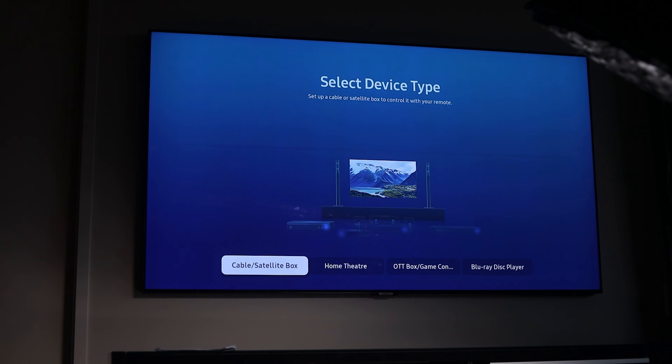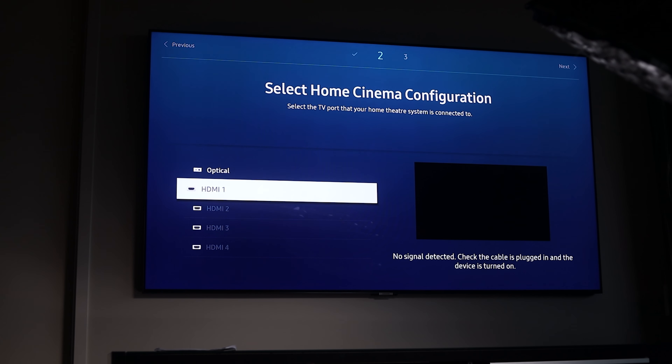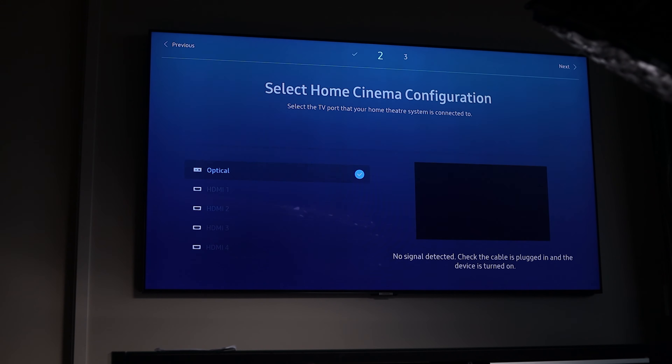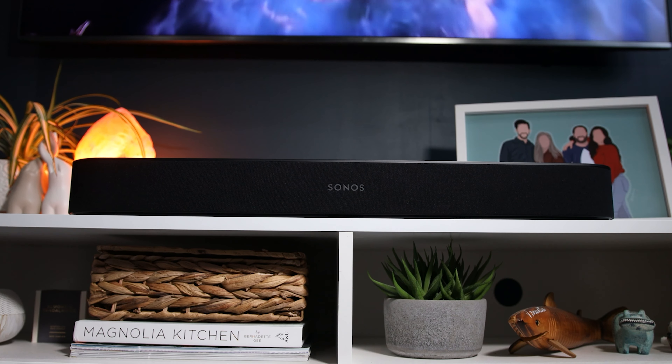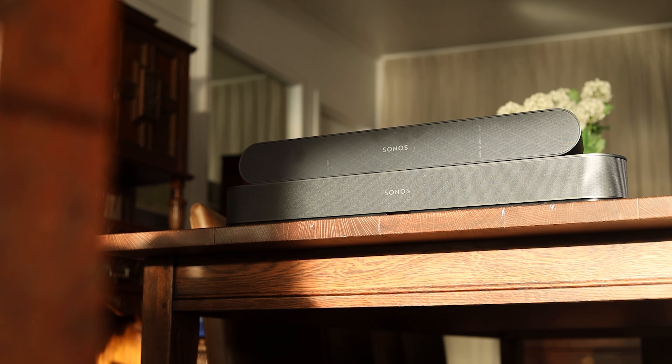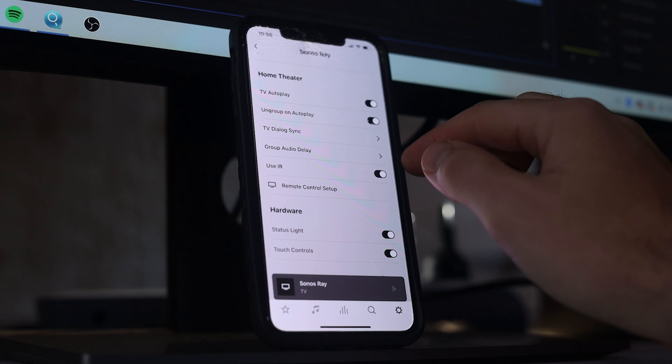While you're in there, set the audio format to PCM as optical doesn't work with Bitstream and will give you a loud buzzing noise, which is easily fixed by changing this setting. With many Samsung and LG TVs you can set up a universal remote which lets your TV remote control the soundbar's volume by sending out the correct signal for your particular soundbar. It's fairly easy to do and the TV will walk you through the steps. Unfortunately it won't turn the soundbar on or off like ARC does, but having volume control from the TV remote is a nice feature for everyday use. Some soundbars like the ones from Sonos will turn on when they receive an audio signal through optical, so check your owner's manual to see if your soundbar has this feature.